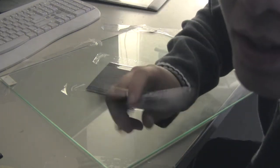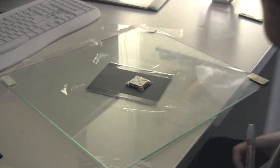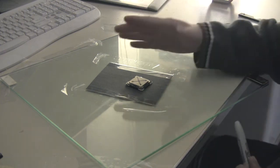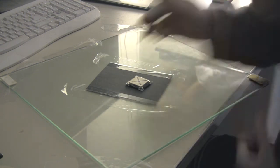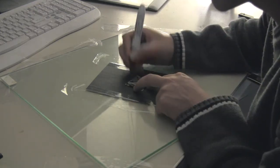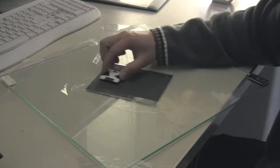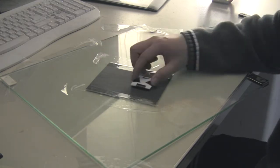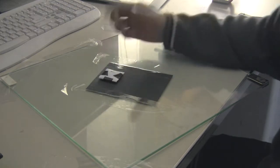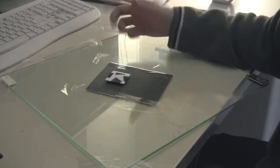We're going to want to get a marker and mark the CPU like this — you'll see it. What we're doing there is just for reference, because later on when you start sanding it's going to tell you where it's not flat. Let's put some more lines there, put it on top like that, and you're just going to move back and forth. I'll do just 10 strokes — some people do 30, some people do 50 — and then they turn it around. Frankly, I can't count past 10, so I'm just going to do 10.